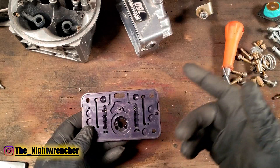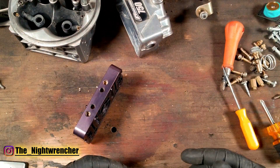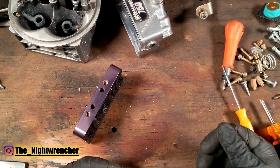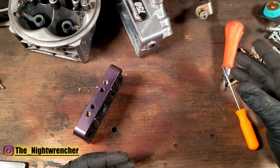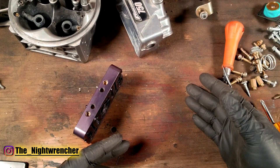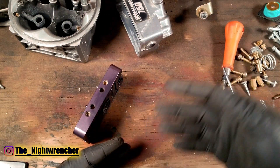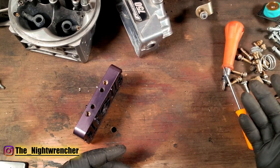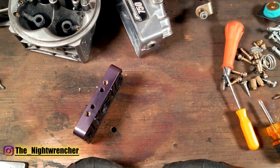The intricacies come from the tuning portion, and I would follow the pyramid I came up with in terms of tuning. The reality is that if you drain out all the gasoline and top it off with E85 and follow my pyramid, you should be able to tune your gasoline carburetor to E85. If you wanted to reuse all your existing gaskets and diaphragms and run it as an E85 carburetor, you could — you'd just have a couple more points of failure. As those items wear out and need replacing, just replace them with the proper equipment. It's not as if you dump in E85 today and tomorrow the car is leaking — that's just not how it works. I'll leave a link to my pyramid video in the description. See you in the next one — Nightwrencher out.